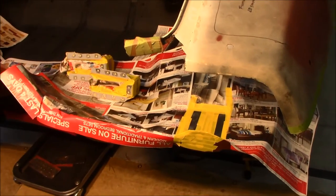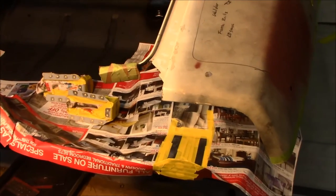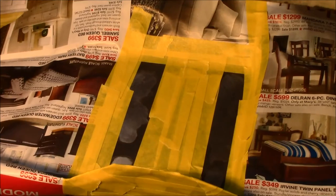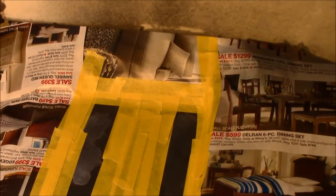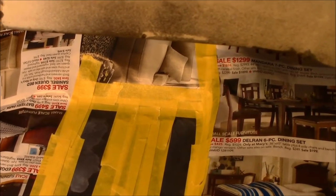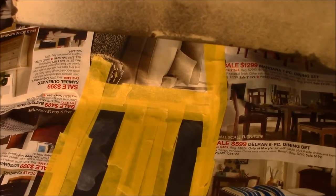Okay YouTube, I have this bumper brace bracket area and the bumper brace brackets themselves prepped for some weld through primer. I've just outlined the outside of the bracket, and I've sanded the epoxy in that area. I removed a little more epoxy than I wanted to, mainly from the welding. I had some of it just lift. I got those areas pretty hot. But we'll go ahead and put the weld through in that area, and then we'll reapply some epoxy later.